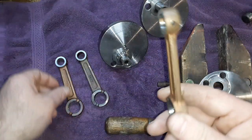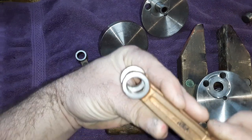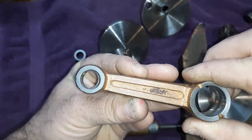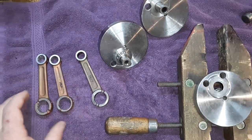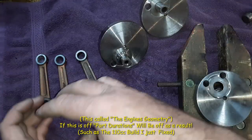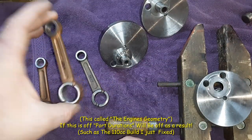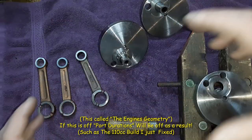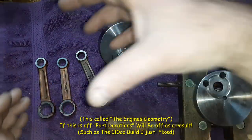Here's another one — this is the short rod, and everyone always wants to know what a short rod is. That's it right there. It's got an offset on it of about 5 millimeters. The reason they do that is for the geometry of the top half to match the bottom half. You have to use a different piston — some will use a high hole piston and some will use a low hole piston.